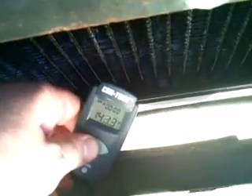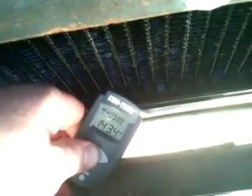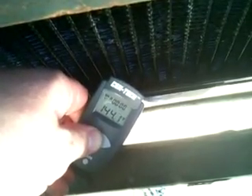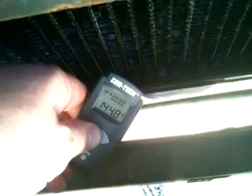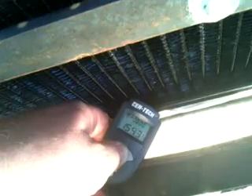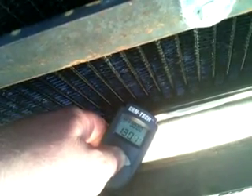I'm back outside now, truck is off, but you can see the temperature is still rising — this is the lower part of the radiator. I've got the Hayden set up so it'll actually turn the fan on a couple of times. It's really hot out — 100 degrees — so it'll go ahead and once it warms up enough it'll run the fan again and cool it off. It really does help in a van body since the van holds heat quite a bit. And there you have it — the electric fan just cooled off the radiator. These Taurus fans pull a lot of air.